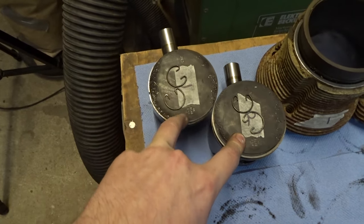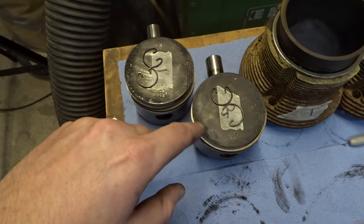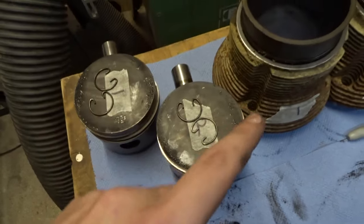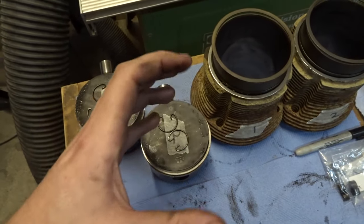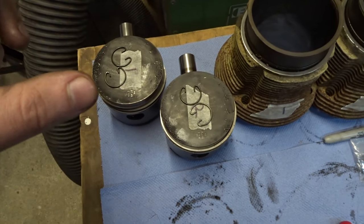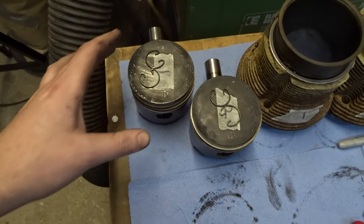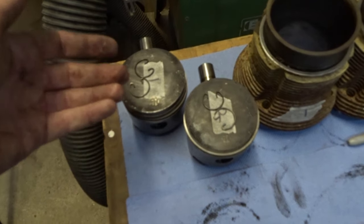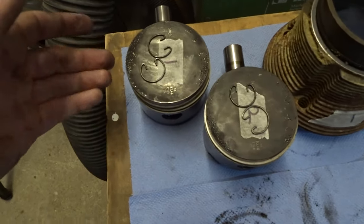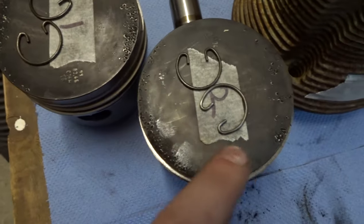This is a 1500 and I've been looking for an excuse to upgrade to a 1600 anyway. I managed to find a pretty good deal on some almost-new, partly-used pistons and barrels which are 1600cc — so they're a slightly bigger bore. They go straight into the 1500 heads and crankcase and should be a straight swap, increasing it to a 1600. We get an extra 100cc, which might give me a little bit of a torque or power increase. I've been wanting to do it for a while, so I thought I'd go for it.